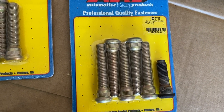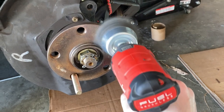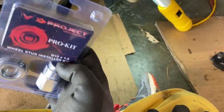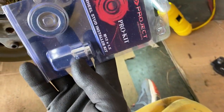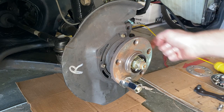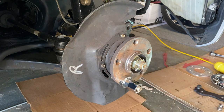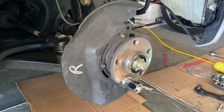I'm going to try this stud installation kit. It's designed to get the stud installed without ruining any sockets or other tools — it has a set of washers to help things move and a hole through the end so the stud can pass through. There's a groove in the hub where you seat the stud. The kit has a spacer, a washer, and a socket with a hole through it, allowing you to pull the new stud in and tighten it properly so it's fully seated. It's only about a seven-dollar tool, so let's see how it holds up.